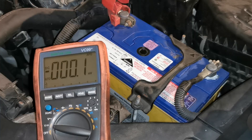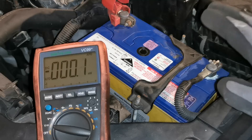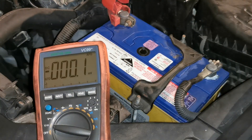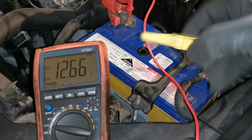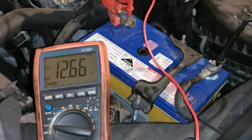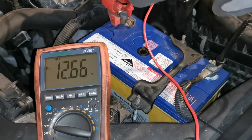The next test is a battery load test, also called a battery crank test, where we want to see a minimum voltage reading of not less than 9.6 volts while cranking the engine. You can repeat this a couple of times to see if it drops after repeated use. We're going to use the minimum-maximum feature on the multimeter to capture those readings. Put the leads directly into the clamps - if you don't have that setup, you can use alligator clamps that feed directly into the multimeter.